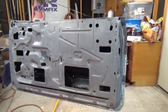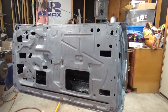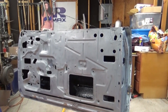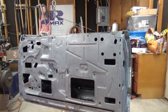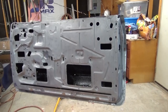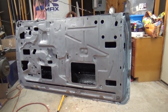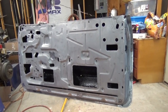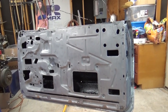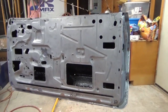I think it was Shut Your Face Garage, and I was asking that question about the sandblasted metal with the oil on your hands. And I guess it goes for bare metal too. Anyway, he suggested just to clean it up, go over it with 80 grit, and then do my wax and grease remover. So I've done that, and I'm fixing to go ahead and shoot the epoxy primer on it and seal it up so that it doesn't stay out any longer in the weather. Well, it's in the garage, but it doesn't stay at bare metal like that much longer.